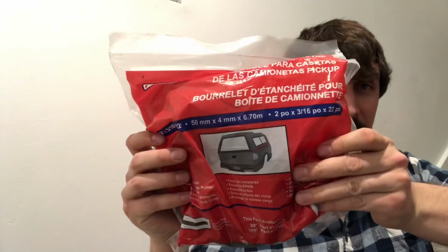One other thing that I would recommend getting, because the stock truck had this on the fuel tank, is where the metal straps meet the metal tank, they had rubber. I think that's a good idea because you're going to have vibration there. You don't want to scrape off the paint and cause it to rust sooner than it's going to down the road already. Less noise too, so I went to Advanced Auto Parts and picked up this stuff right here. It's adhesive backed. I put that on, you saw that in the video earlier. I think that's going to make it look professional.